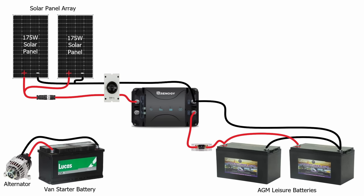To complete the charging side of this system we just need to connect to the vehicle battery. We go from the positive out on the vehicle side of the charge controller to the positive on the vehicle battery with an inline fuse for protection, and then from the common negative to the negative on the vehicle battery — that completes the charging from the van. With that single controller in the middle of this diagram it's really simple: solar generation comes in to one side, generation from the van when driving comes in to another side, and then off the controller to our leisure batteries. With this one combined charge controller we can meter both sources and charge our leisure batteries accordingly.